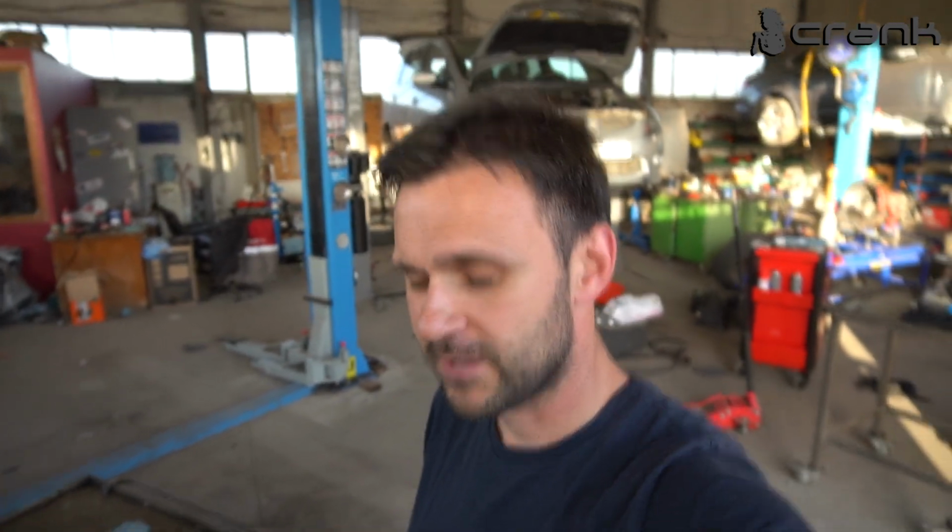For those of you that are going to ask, is there any excessive vibration or anything like that after the installation of the stiffer M3 S54 engine bushings? No, there isn't. We have tested the car. The car feels all right. Everything seems fine. The main issue which we had was that the engine was moving a little bit more forward than needed after the installation of the supercharger, because it has a little bit more power. So that's why we have done this.